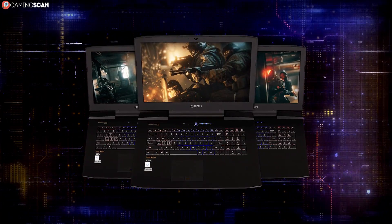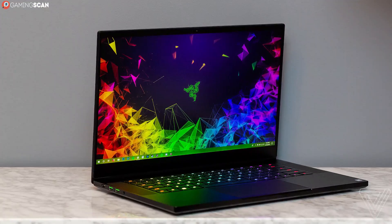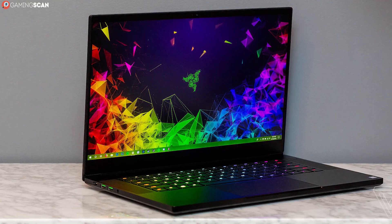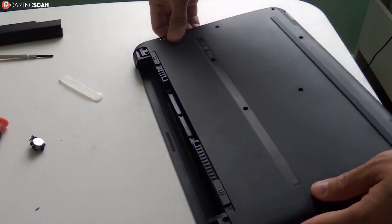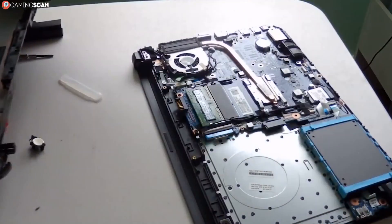And lastly, if your laptop is still overheating despite doing everything in this video, then the fault may very well lie in a faulty fan. Most modern laptops have multiple internal fans to keep all the components cool, especially gaming ones. If one of these were to malfunction, the entire cooling system would be compromised. Short of opening the laptop, the best way to check whether you're dealing with a faulty fan is by ear.